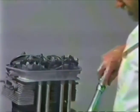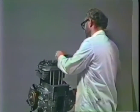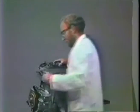And don't forget now, we have to put the push rod. Torque wrench to 15 foot-pounds, and then torque all the nuts to 15. Now occasionally you'll strip a nut, especially a nut that's been CAD plated. The smaller, thin 13mm nuts tend to strip a lot. So if you do CAD plate these, you should have a few extras just in case, and these are special. So like I say, in an emergency you can use a regular 13mm nut. But if you're careful and torque them carefully and don't over torque them, they'll be okay.